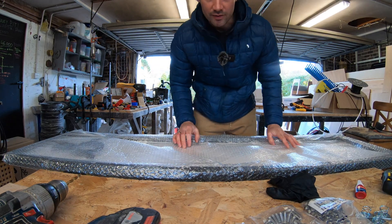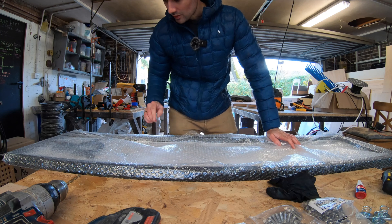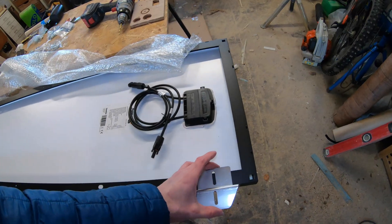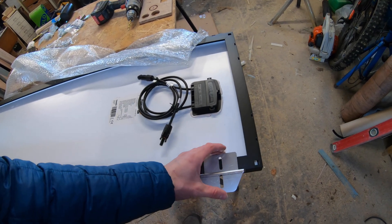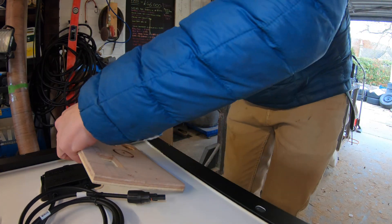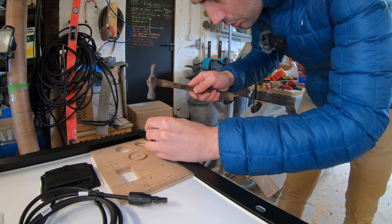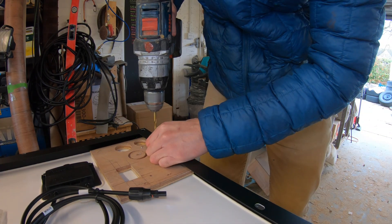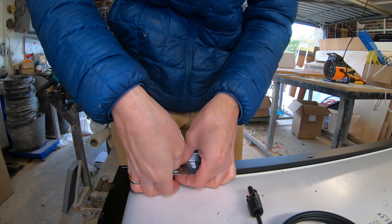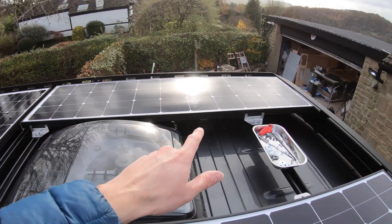New day today — ran out of light last night. Did manage to get the third panel up, and I want to show you how I drilled it. For the far end I can use the existing bolt-down holes in the back. For this end I need to be around 9.5 centimetres in. All I'm going to do is mark it out, drill it, and then bolt those in position. Safety wood behind so we don't put the drill bit through the solar panel. Centre-punch — or in this case, a screw. Aluminium looks dead easy. Same process: penny washer, penny washer, spring washer, M6 bolt, nylon nut, tighten up. Let's throw it on the roof. The other one is already in position so it's just a case of repeating that process.